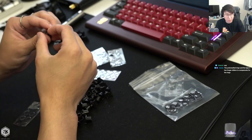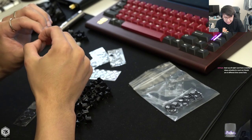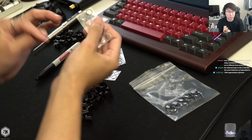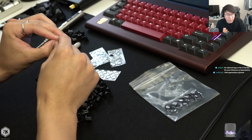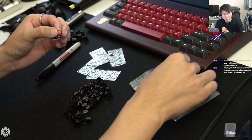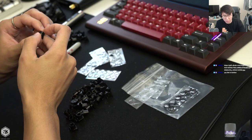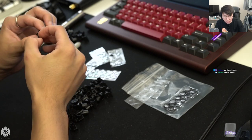iFusion 5194. Anyone tried those creamy linear switches from Play Keyboard? I have not. Waffle High is the only difference between the standard HHKB and the Type S, the pre-installed rings. Pre-installed rings plus the Type S has slightly longer sliders to account for the thickness of the ring, because the ring reduces travel by a little bit. But otherwise, yeah, same board.